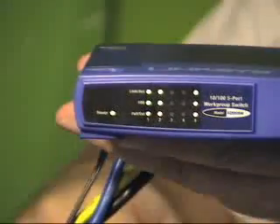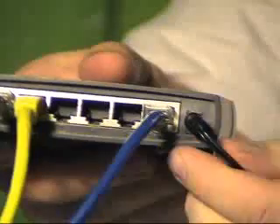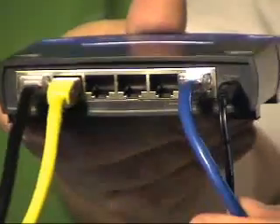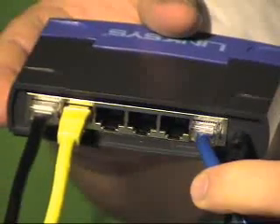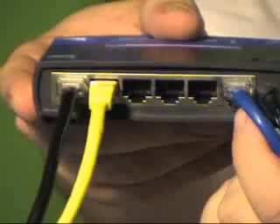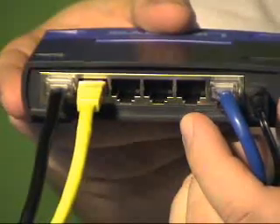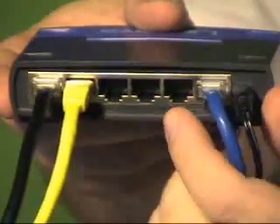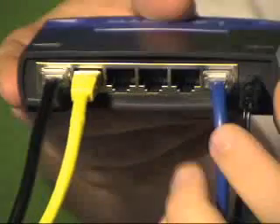If we turn this around and get a good look at the back side, you've got your power adapter — it only goes in one receptacle. This blue RJ45 cat5 cable goes to my data source, like my wall jack, and that's plugged into the uplink port because that wall jack goes to another switch. Directly next to it, the empty port number five cannot be used if you're using the uplink port — these are connected internally. You can use one or the other.